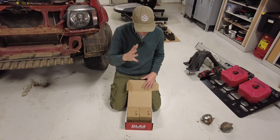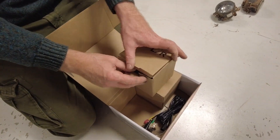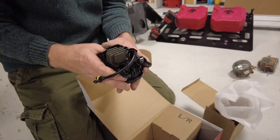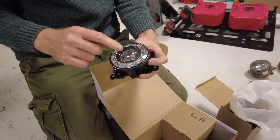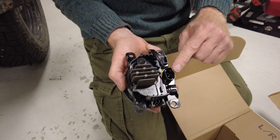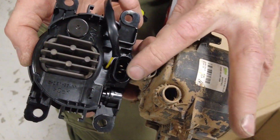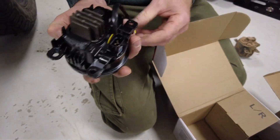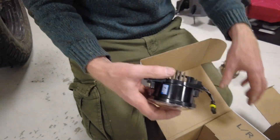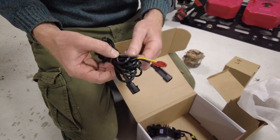We're going to upgrade these to LED DRL fog lights. Here is our set of upgraded lights — these should maintain the fog light function but also have an additional daytime running light we can connect to. The center bit gives us an LED fog light, powered by this connector which should be exactly the same as the connector on the old light, so it's going to plug straight in. We just need an additional feed from an ignition live for the DRLs. Both lights are the same, not handed.